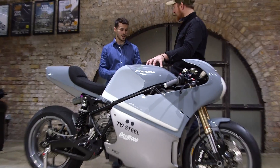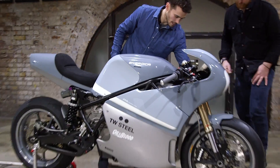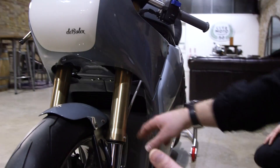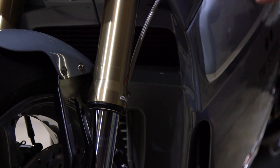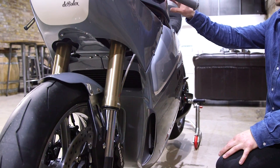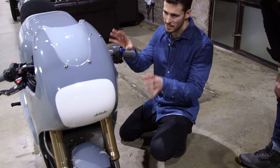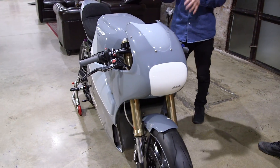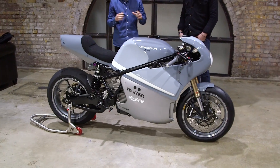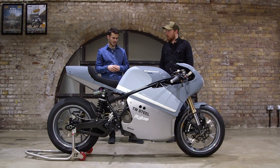The control unit is water-cooled? Yes. We've actually got a cooler and that started us off with this design — the cooler's at the front there, like a traditional fin and foil unit. When we came in, there was a big water pump on the side, so we relocated that and it's now sitting snugly just behind this part here. Also the ABS, which sat the other side — those were the two components we had to move, and once we'd done that, we stood back and had the perfect base. As far as electric bikes go, it was fairly sleek. It sat really nicely.